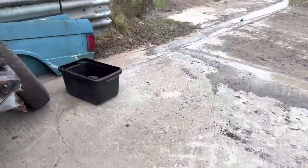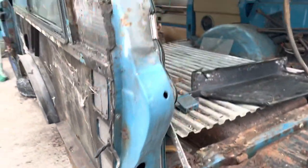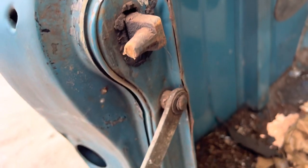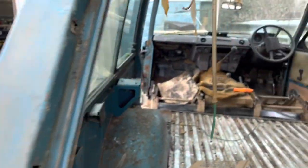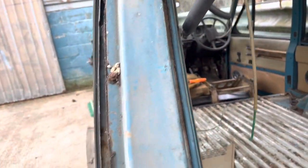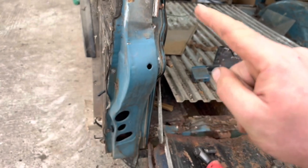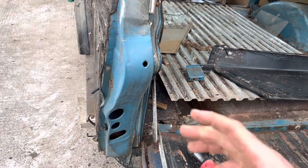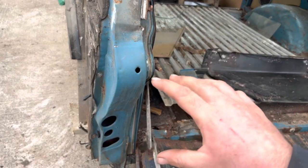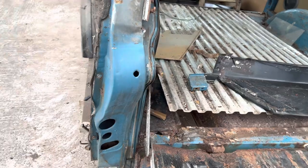A little bit of forklift damage has basically meant it's a little bit twisted - you can see how twisted it is down there, where it's been pushed through. However, it's not going to be a massive problem for us. The whole goalpost is absolutely rotten at the top, so there's very little reason to replace the whole thing. What we're going to do is cut this whole section out, remove it, take the top skin off, straighten the back, and then find a way to use the hardware from inside and swap it out for the one on the actual tailgate.